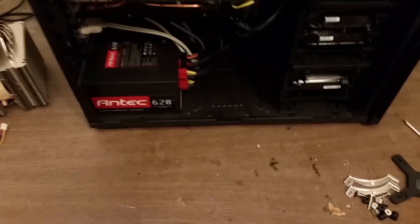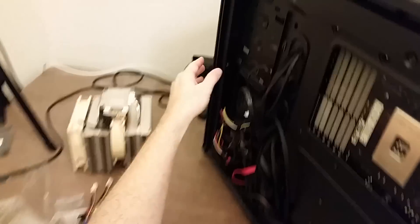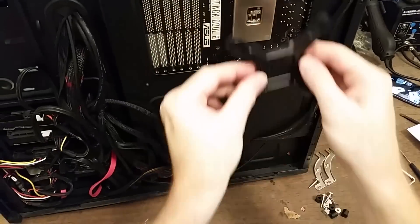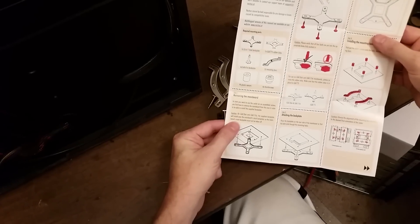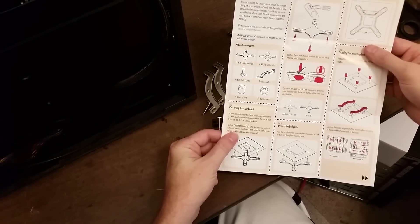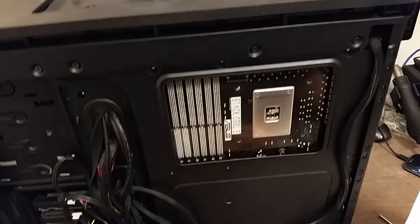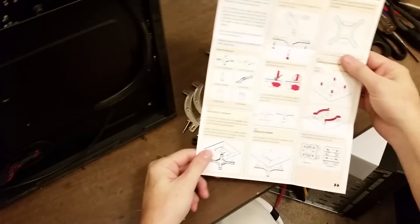I'm going to spin this around and take the other side of the case off. The back plate will go right through that cutout — so no reason to take the motherboard out of this case, which is great since that's a pain. The directions say on socket 1366, the supplied back plate will install over the mainboard's stock back plate, so the main board's stock plate must not be taken off — and I couldn't take it off if I tried anyway.